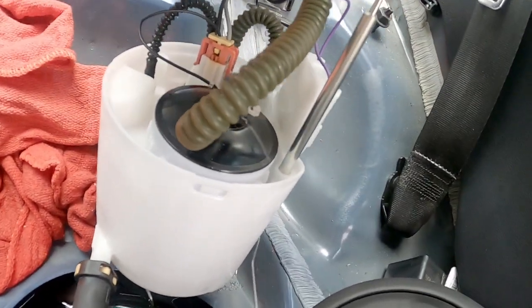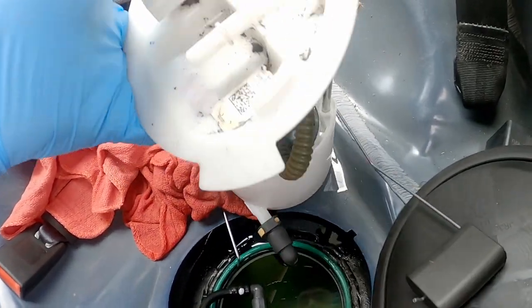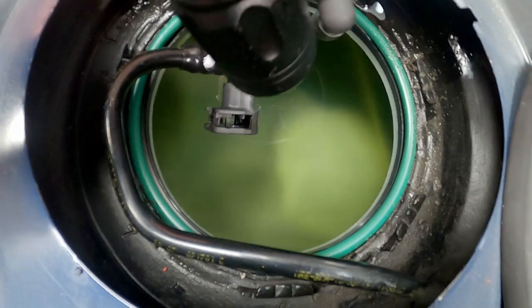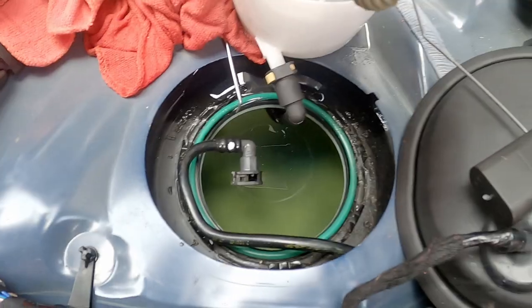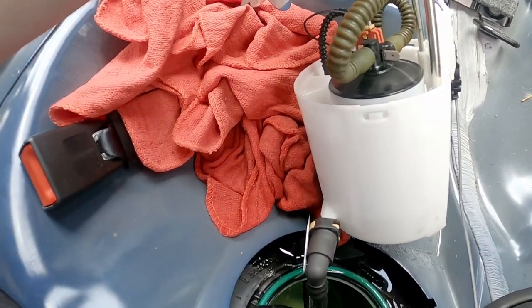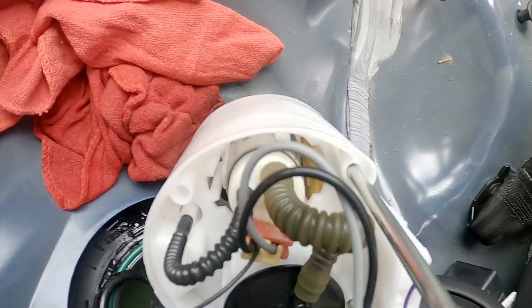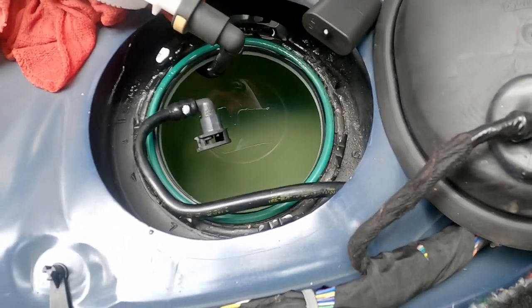Let's go ahead and take a look at our pump. Everything looks fine — nothing looks goofy or messed up or nasty or gunked up. Everything looks really, really clean. And looking down in the fuel tank — it's clean. There's a couple things floating around in there now, probably from knocking all this gunk in, but it's clean. There's nothing going on down in there, which is really nice to see. With all my shenanigans and pouring all that stuff in the tank, it doesn't seem to have made any difference for the fuel system. All the lines look good, the pump looks good, and the strainer in there looks fine.